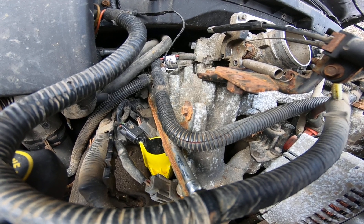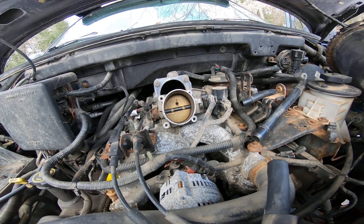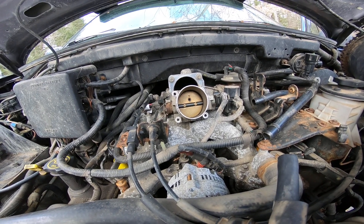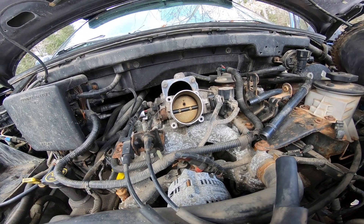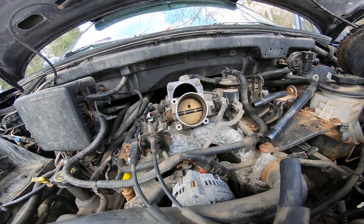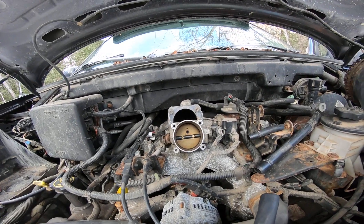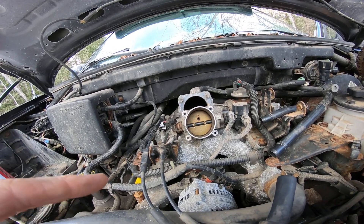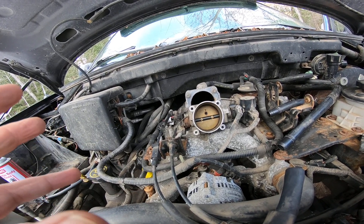But if it ain't broke, don't fix it — just for now. I'd like to get a stainless steel replacement. I don't know what kind of parts I'll be able to get for this, but if I can upgrade with aluminium and stainless steel stuff, then I never have to worry about corrosion as much. I gotta go get my safety goggles because when you're working with sprays, you can get that stuff in your eye. My strategy: clean the throttle body, clean the airflow sensors, start looking at some hoses for leaks.